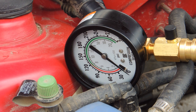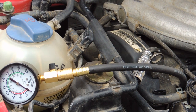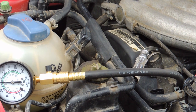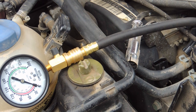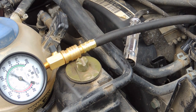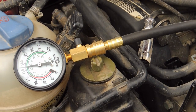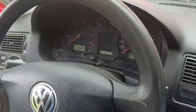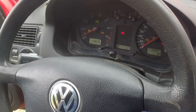Now I'm going to push the gas pedal all the way down to the floor and crank the engine seven times. I'll do the same number for each cylinder to make sure we get the most accurate reading. Cylinder number one dry test: 160. Cylinder number two dry test. Cylinder number three — gas pedal all the way to the floor — one, two, three, four, five, six, seven.